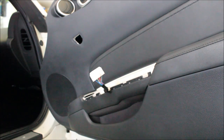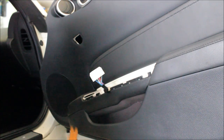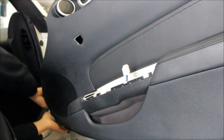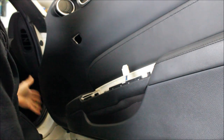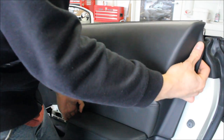Once you've got all the fasteners off the main door panel, a lot of people like to use plastic panel popper tools — I highly recommend it. However, there is a downside: sometimes you might scratch the paint on the inside, but it doesn't really matter. On this car, I try to use my hands as much as possible. I put my knee up against the inner part of the door to counteract the force of pulling. Then I try to find a good grip on the inside of the door towards the front — there's actually an overhang where I can grab it. At that point when you've released part of it, the rest comes easy. Most doors are set up with pushpins holding the panel, and the last part where the weather stripping actually hooks on. If it's loose like this, don't pull anymore — just be gentle and lift straight up.